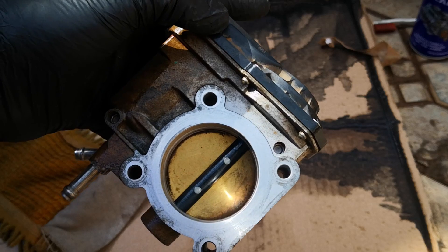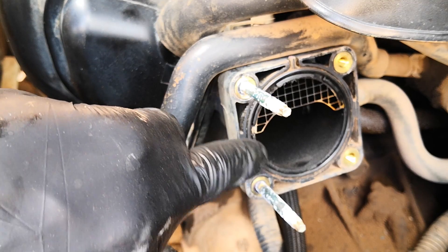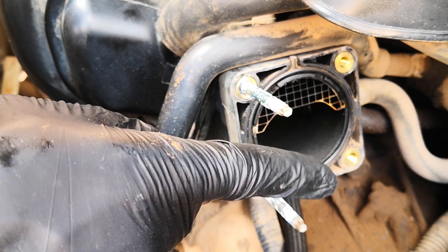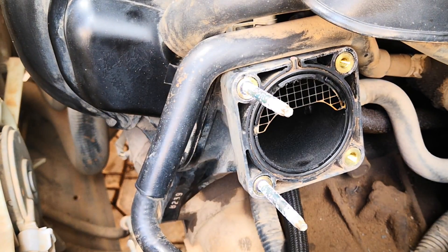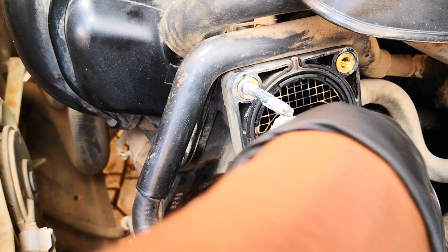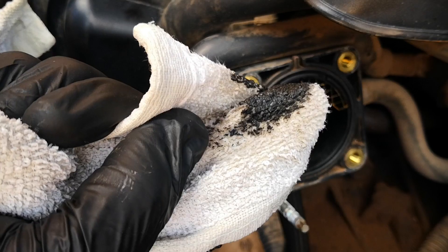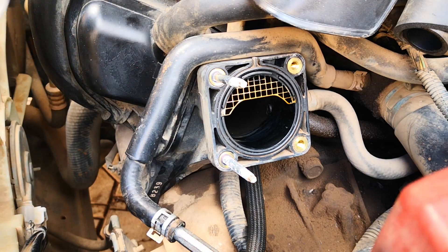Let's turn our attention to the intake manifold. There's an o-ring here — you really want to make sure that you don't damage it, and be careful with your use of carb cleaner around this o-ring so that it doesn't deteriorate. Spray carb cleaner onto a rag and then clean it. There's really not so much you can do here. That's done — we're going to put this back together.